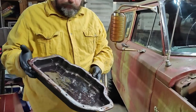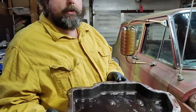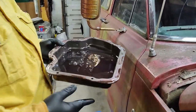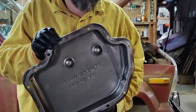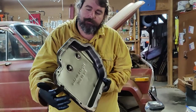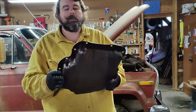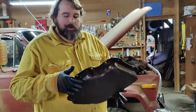All there is to do is clean this out and then check for leaks elsewhere. I need to figure out how to change the O-ring on the fill nozzle because I know it's leaking. I'm going to sand lightly - there's some rust on the edge, the inside is good but the outer edge is kind of rough. I'll sand it with some very fine grit sandpaper to try to smooth it out so it'll make a better seal, because only half the seal was sealing.